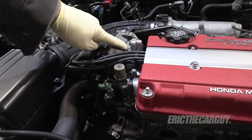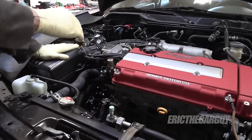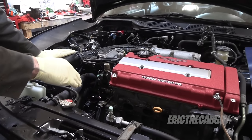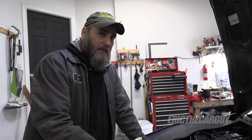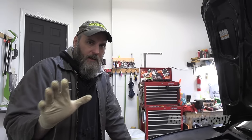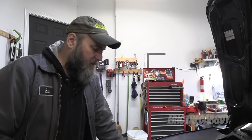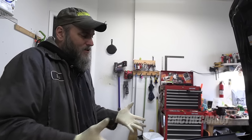The distributor has an O-ring behind it that I also replaced. I went inside the transmission and put a new limited slip differential in it. I was going around turns and I felt that one was making a little bit of noise — the original equipment one, which I still have. But I went with a wave track differential for this. There's a whole debacle on that — there are other videos I can link for you. Anyway, this got a brand new clutch and a brand new limited slip differential.